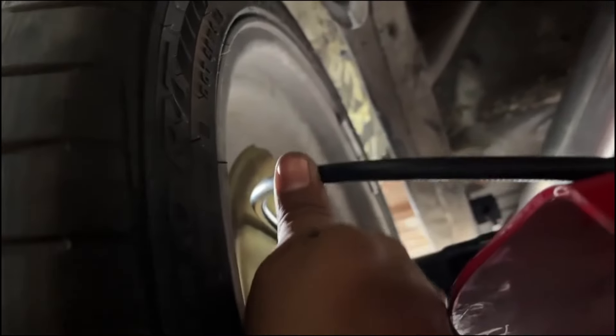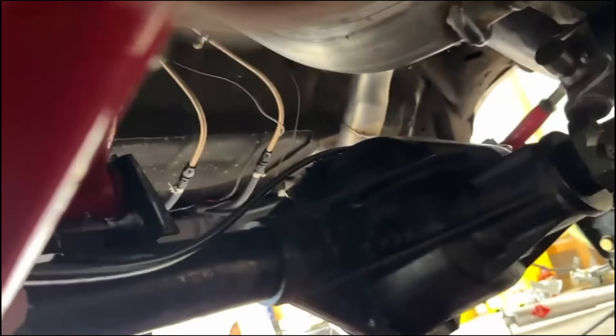Here's the shot of what it looks like under the car. I'm making sure the wheels clear and that nothing is going to be touching the exhaust. I'm also going to use these two holes in the frame — the bottom one is where the original ran through — and I'm going to make them both bigger so each line can run through its own individual hole.